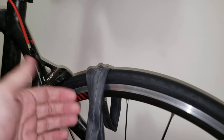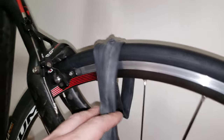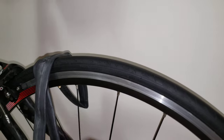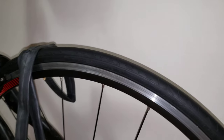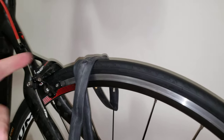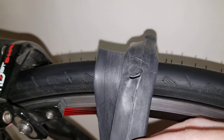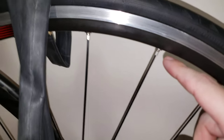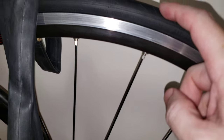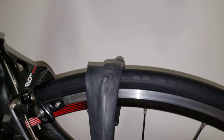The other day I tried to inflate somebody's tires and as I came to 20 psi I heard a quite loud pop. So we had to open up the tire and get the tube out. If you look at the shape of this here you may be able to recognize what's going on — the nipple screw that's holding the nipples has punctured the gentleman's inner tube over here.